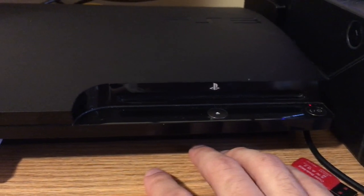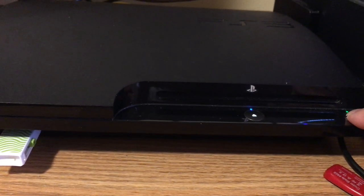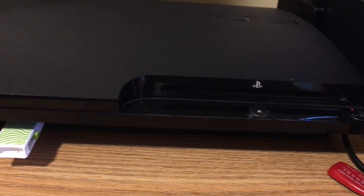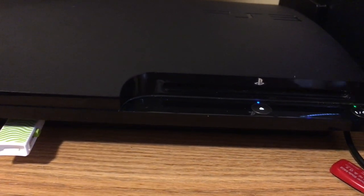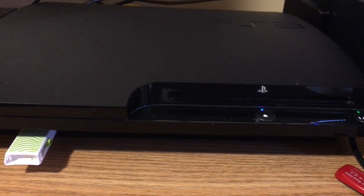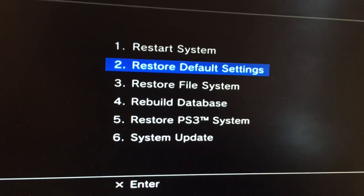Make sure your USB drive with the system software update is in the USB port of your PS3. If you're using custom firmware or want a jailbroken PS3, make sure your Wi-Fi is off and there's no disc in the PlayStation 3. Now hold the power button down for the first time and keep holding it until the system shuts off — we need to put the PS3 into Safe Mode. You'll hear the last beep, keep holding, then let go and the PS3 will shut back down. Hold it again, and when it beeps two times that's when we enter Safe Mode.